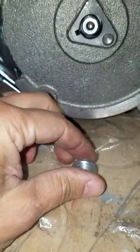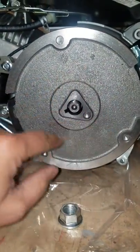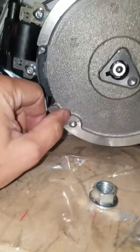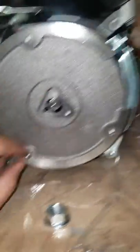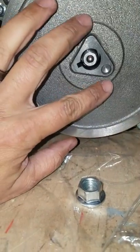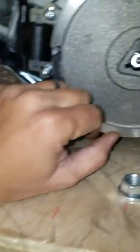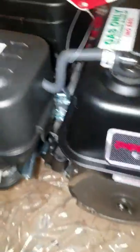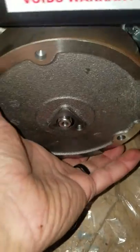I have separators and I have pullers, but there's nothing tapped there so there's nothing for it to grab. I don't think this was really meant to come apart by the average person. Ordinarily you could probably get away with drilling and tapping and then putting a steering wheel puller in there. I have a gear puller somewhere but the arms are not long enough to get a spread. What I could do later for my own benefit is fabricate some longer arms for wider pieces like this.